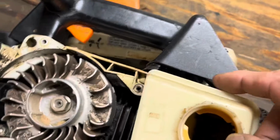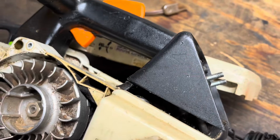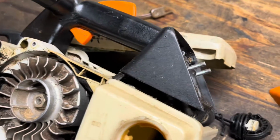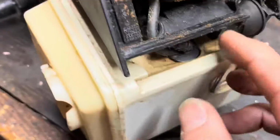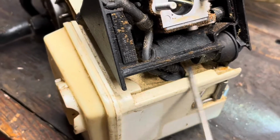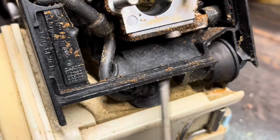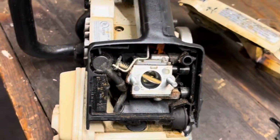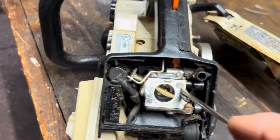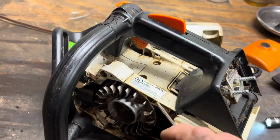All right, that line is hard. I mean, it's rubber, and this was made in 2009, so it's 13-year-old rubber. The other thing is the fuel line is hard. I'm not hitting anything but the fuel line. It's as hard as plastic. So we're going to throw a new fuel line in here, put a kit in the carburetor. I haven't even taken it apart yet, but I'm sure it's all wrinkled up. And a new impulse line.